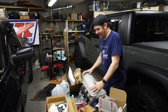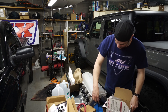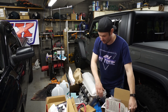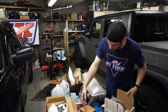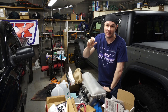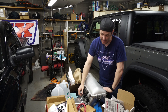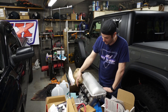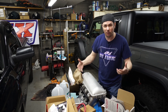Let's take a look at some of the parts. We have the Holley Hi-Ram with the rails installed and the 42 pound injectors. Here's the MAP sensor mount on the back — it has a bolt that goes straight in with some vacuum ports. I've got a fitting to go into one of the vacuum ports, and I'll probably bring another one out. We're going to run the fuel fittings into the rails off a T — Earl's makes a quick disconnect device that only adds about that much length to your factory fuel rail fitting, with two 1/8-inch MPT outputs. We'll see if we get enough flow. We're running a non-return system, so we should maintain good pressure. Might need to put a pressure sensor up on the front of these rails.